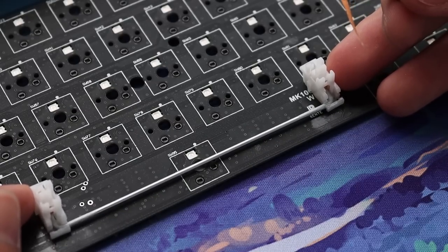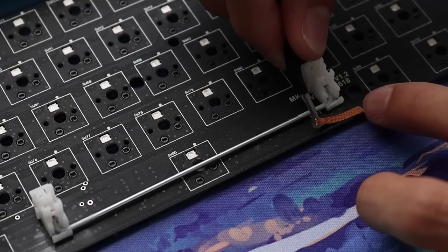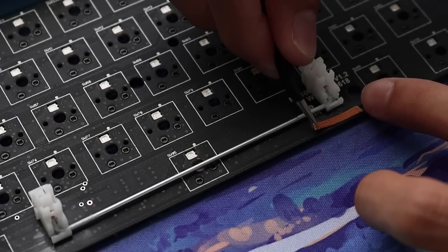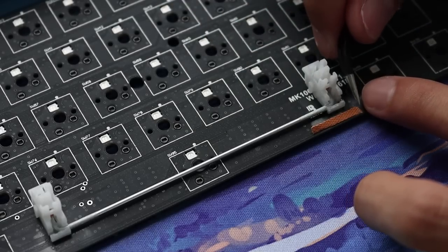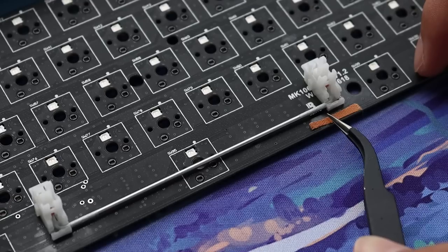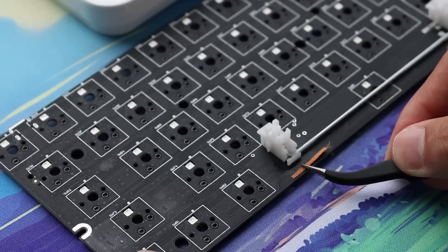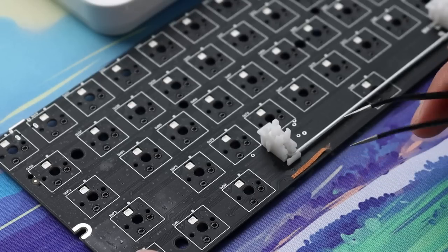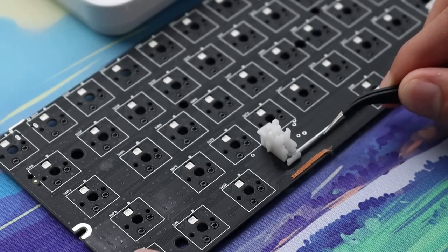As for the spacebar, all you're gonna wanna do is apply the same thing but on both sides of the stabilizer. So yeah, the holy mod plus the anti-ticking mod will take care of any ticking internally and externally.